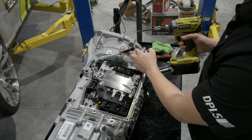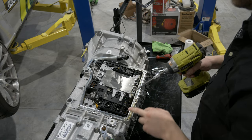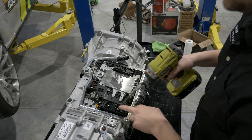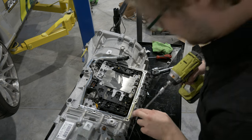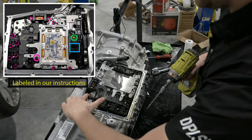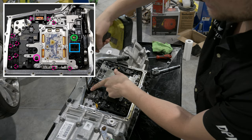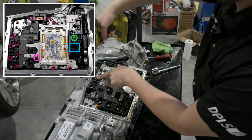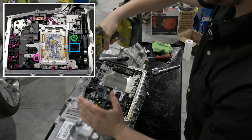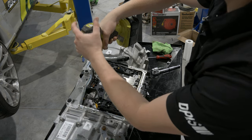Once the wires are pushed away, we're going to loosen — not remove — but loosen all of the sensor fasteners. So there's one, two, three, four, five, six, seven down there — this is the RPM sensor — and then eight over here. They're all retained screws, so we're going to leave them where they are, but we're just going to make sure they're not threaded into the transmission at all anymore.